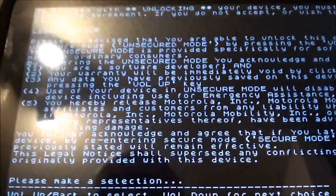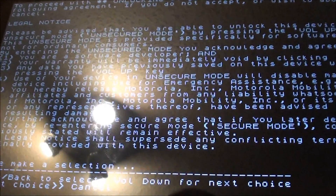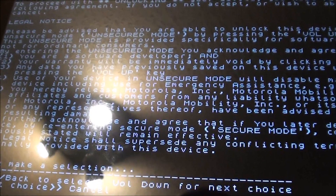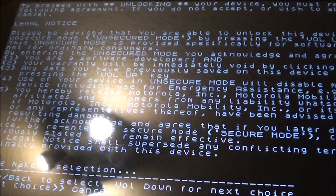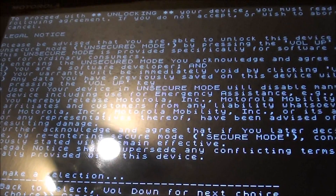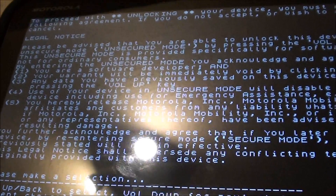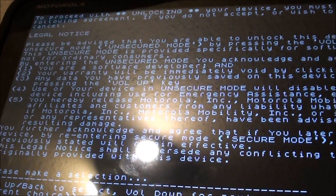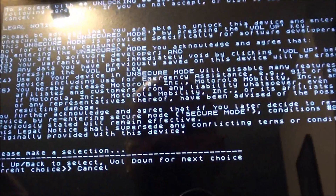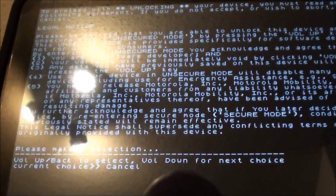So you saw me run those commands. I had a slight problem that some people have — not everybody. I had to copy my ADB and some WinAPI files from the platform tools folder into the tools folder to get this to work. I don't know why not everybody has the problem; I don't use ADB much. I'm going to include a small clip at the end to show what files to copy and how to move them if you need to. Now this is your screen with all your information asking if you're sure you want to do it.